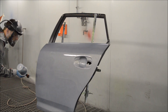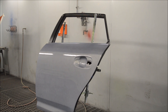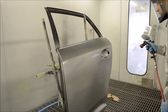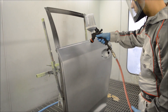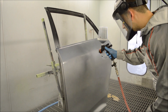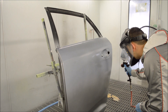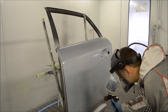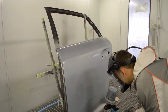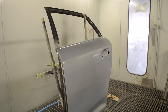What you'll find with this kind of setup is it atomizes the paint a lot finer — almost like a mist rather than what the HVLP gives off. This HTE technology applies the metallic a lot finer and a lot drier, which can be a good thing. The gun breaks the metallic down more than HVLP would, applying it more evenly. As you can see, the base coat is applying very smooth and even — no stripiness, no build-up, and no unevenness from the full wet coat that you'd sometimes get on HVLP.